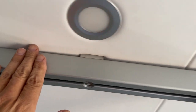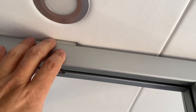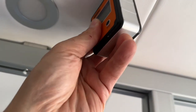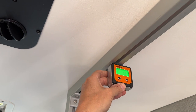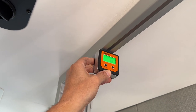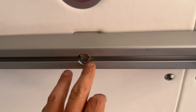I'm going to have my cabinetry come up and basically seal this off so you won't see it. One thing I did find was that I needed to go a couple degrees larger than what I measured when I just put the level up to the ceiling, in order to really get at 90 degrees. The way I would test that is I would put the shim in, tighten it, and then measure to see what my angle is, and then adjust again if need be.